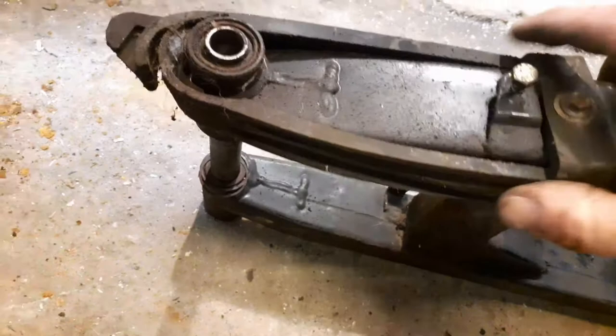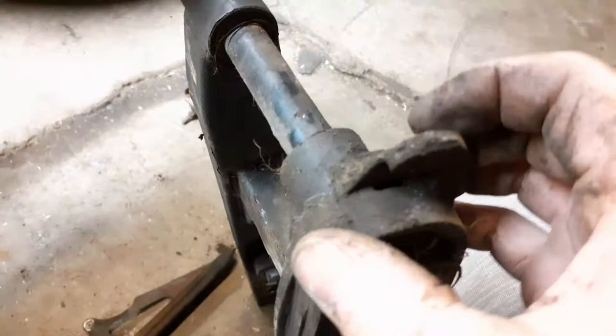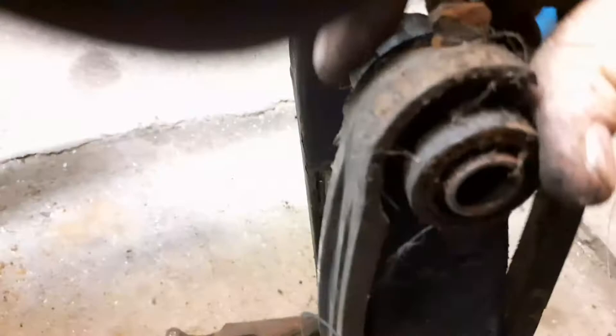So this is just the chain guard protector rubber, whatever you call it. It's actually in two parts. You unbolt that 10mm bolt there, and on top of here it just unclips. So that pulls off. It's like this, look, this little shape, a bit of metal sticking out. This side has a hole in it, and this side has a hole in it, and they pull off over the top of there. If I can get it off, one second, a little bit tricky, there we go, and that's off. Under that 10mm bolt, and that's that done.